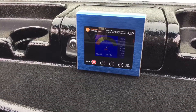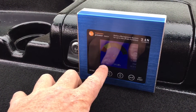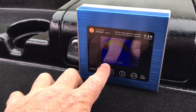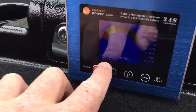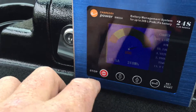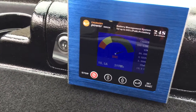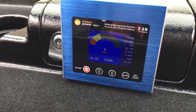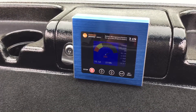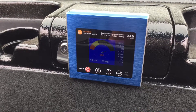As you go into regen this will go up and say negative 10.5 amps as you're getting on the gas, and then when you let off the gas and go into regen this number will turn positive — there's no negative in front of it — showing you what's going in. You can actually see your amperage as you drive going in and out, and it's quite a useful tool for trying to save electricity. It makes that right foot a little bit softer as far as how much energy you decide to put in or out.